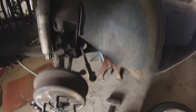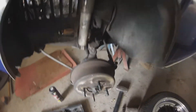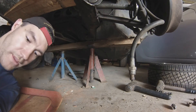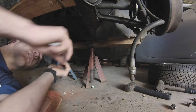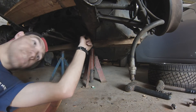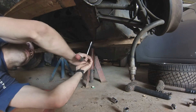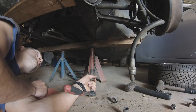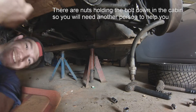Taking off the tie rods — this one was a proper stubborn one, had to take out the big four-pound. Tie rods disconnected, and the gas struts from the whole front hub assembly. Now we're going to tackle the bolts that hold the subframe up from the front and on the rear. Under the car, we can see there's one and two bolts over here. The top one is a 13 mil — so it could be a half inch — and this bottom one is a 15 mil. I have a slight feeling that they're connected on the floorboard of the car. Yep, it's connected underneath the car — so let's cut out the carpets and go find these bolts.